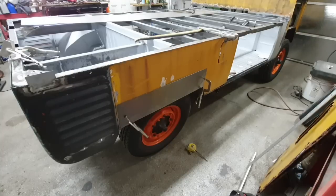It just makes people feel better when it's butt welded in. Not exactly the strongest way to do it, but it makes people feel better. So it all depends on what you want to do. I don't like to do it that way. It takes a little longer and it's not as strong, so I prefer doing it lap like the old school way. Years ago when I worked in a body shop, if you got caught butt welding something in, you'd lose your insurance contract. It'd be over real quick, because the strength isn't there. Today, on the old 16 gauge cars, it didn't really matter that much.